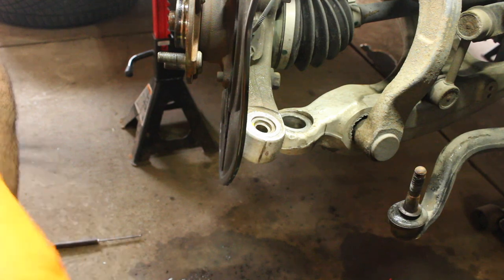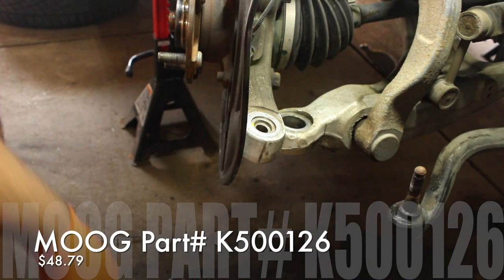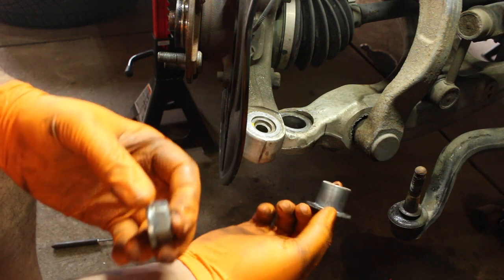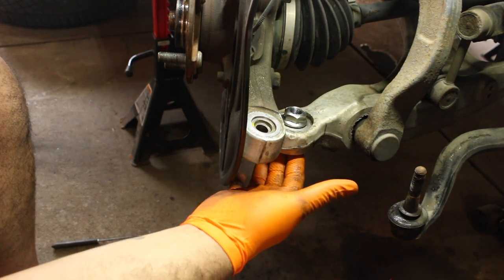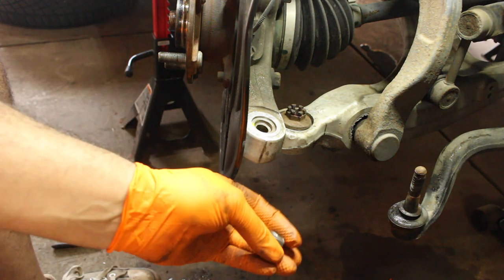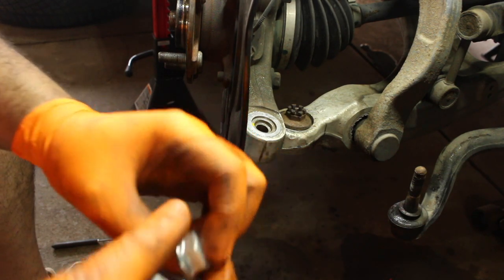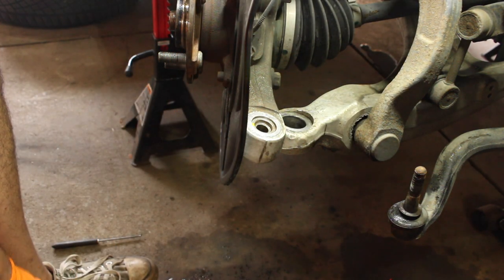So we have our new part — you can see the part number there. This is one of the premium versions; price will be listed in the description. The problem with this part is that these are the bolts it comes with. This spacer piece goes up through here. This nut is so small in diameter that even if you bolt this up, the whole thing can pop out — the material will wear away and it will come out. Whereas the original bolt fits right inside this cup. So you have to reuse that original hardware. I would not recommend using the included nut — it's the wrong size. You need the surface to bear on the control arm, not just on this washer.